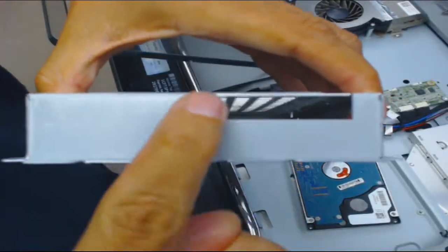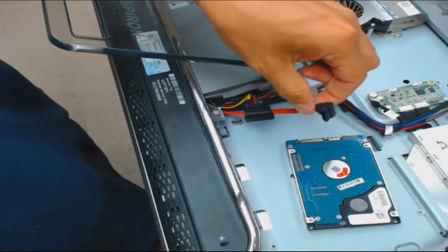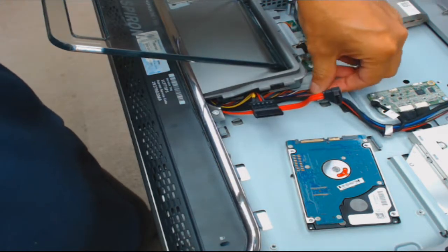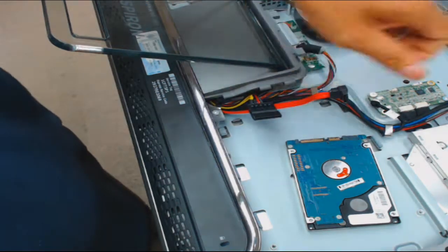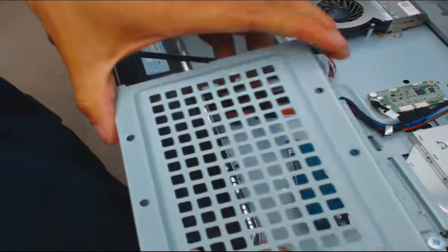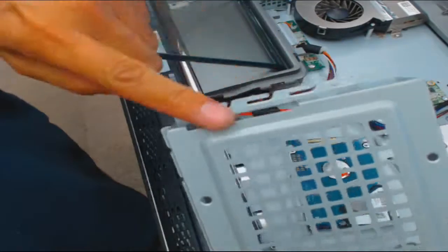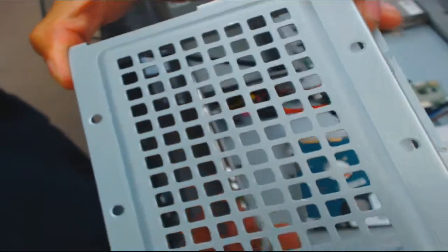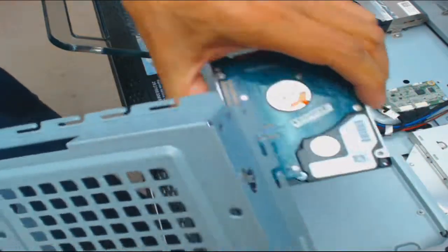I want to make sure the connections are as close to the opening as possible. You need to be aware of how long the cables are - I don't want to break the factory cable ties. You do not want to start yanking cables because you need more length. I don't want the hard drive to sit too far back because originally the connectors were right near this opening.